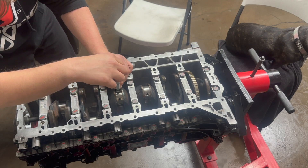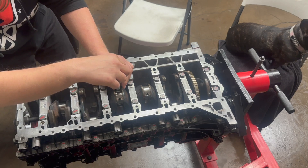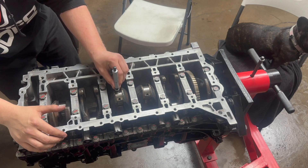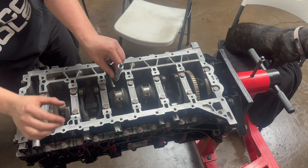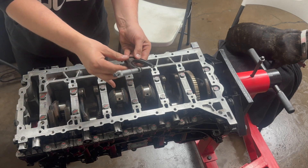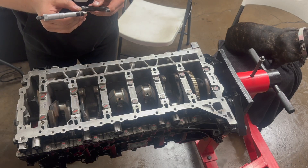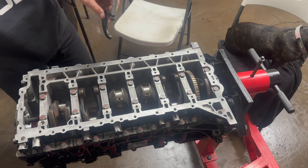I'm going to do the third one. Just need a click, get this mic to sit there, push it through, pull it back — should have a slight resistance. Pull this out and boom — 1.968 again, which is exactly what I'm looking for.